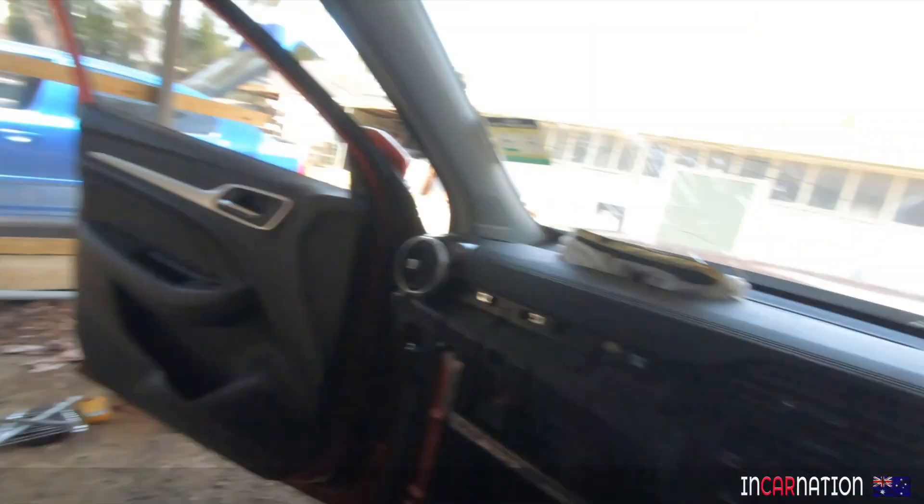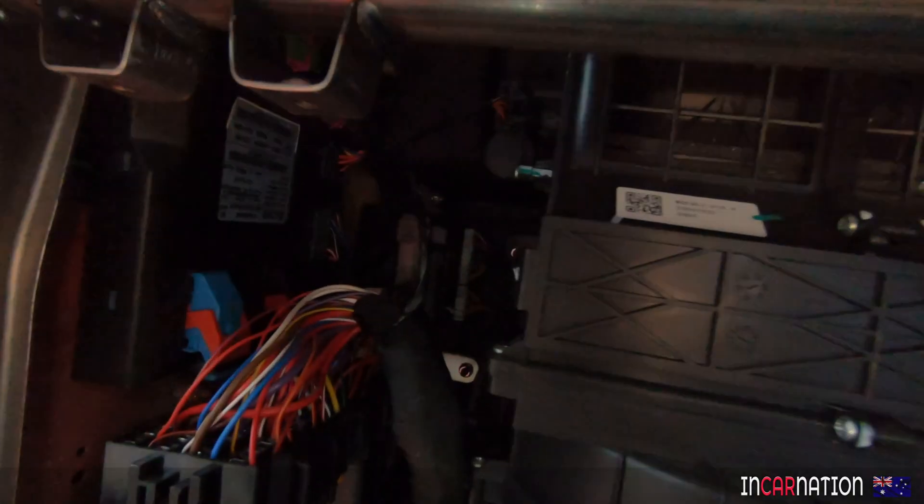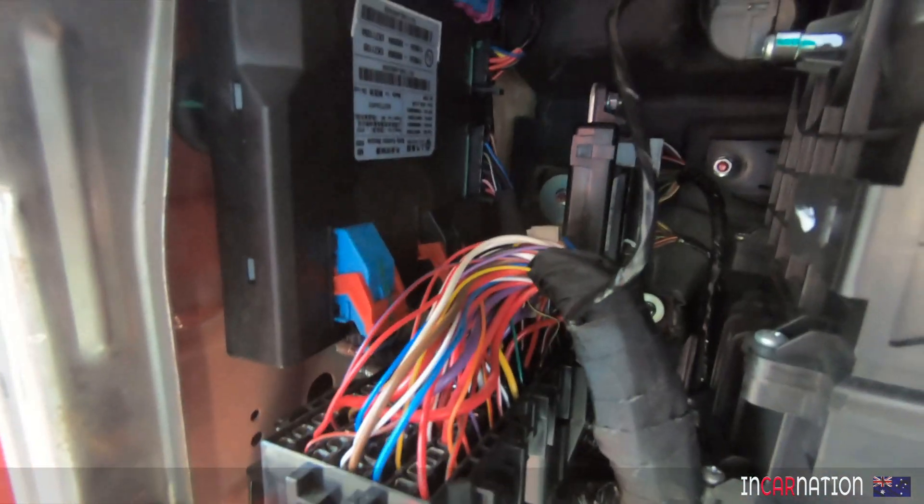Dash is good. We've got a minor problem with the hill descent thing - a little warning there. But I can go, drive and drive the car. The one thing we can't live without is behind there - that's the body control computer and its associated fuses. We do need the body control computer because without it, the key doesn't work, the dash doesn't work, we don't know what we're doing and it won't activate itself. But I'm staggered that we can disconnect so many things and the car still drives.